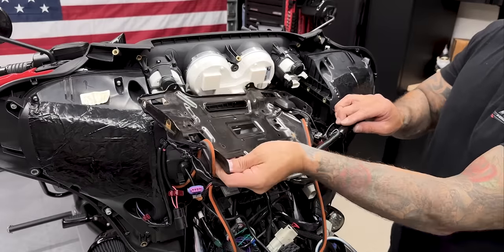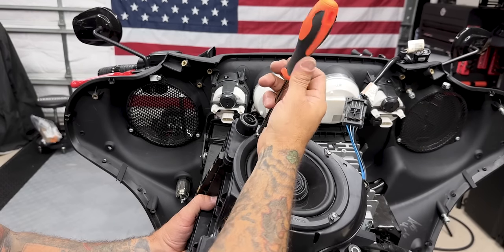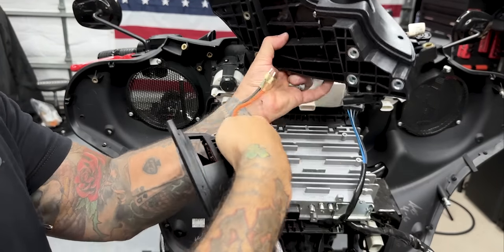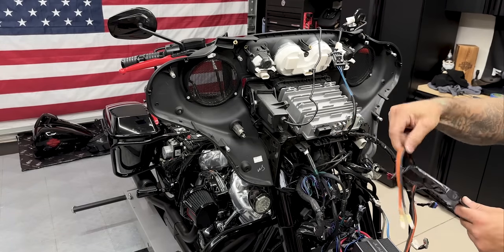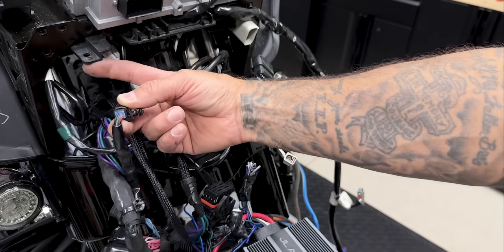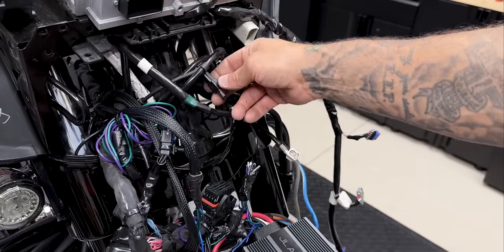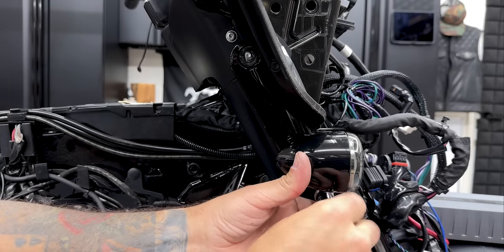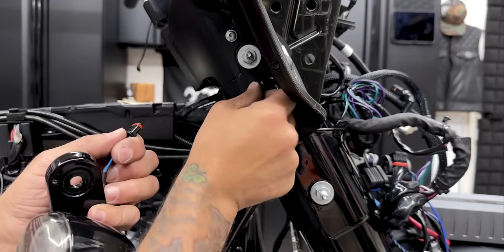Whoever wired up his system ran some wires through places where we had to take off the speaker pods and disconnect them. Your setup probably won't be like this, but if it is, just work through it — make sure you get all the wires running towards the neck disconnected. Here you have your twist grip sensor — push tab right here, use a picking tool, it's usually located with the Christmas tree connector, just pop it out and disconnect it. The ground is not connected to the fairing so you don't have to worry about that. Remove the turn signal — two acorn nuts, half inch — disconnect it and run the wire through so it doesn't snag on the fairing.